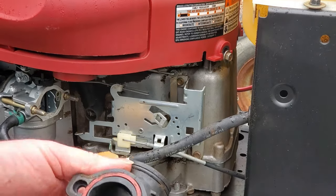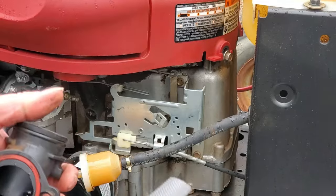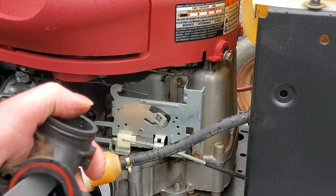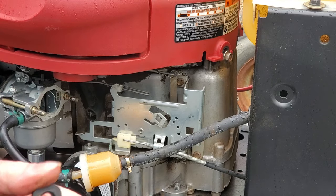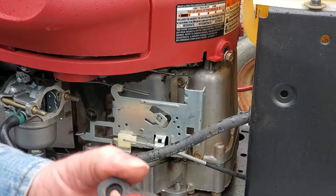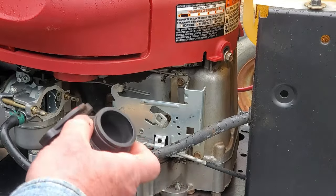I'm going to open this up a little bit on this side with a half-round file. I did have a smaller one but can't find it, but this one will work well enough. Opening it up on the top a little bit — same area, same size. Now I need to go clean this with some carb cleaner. We've got this opened up a little bit — let's put it back on and see what happens.